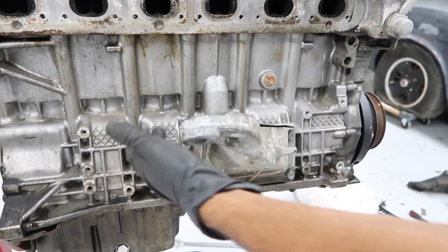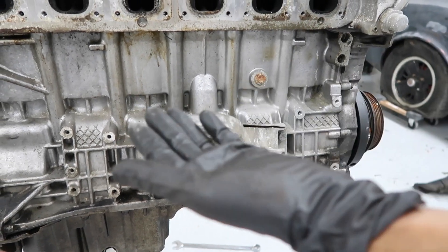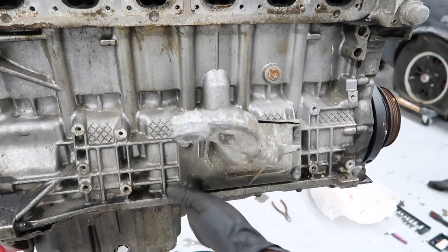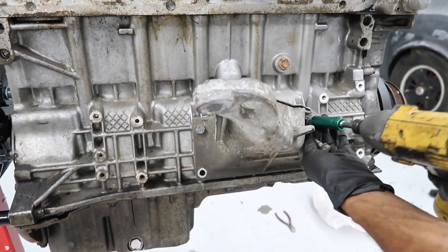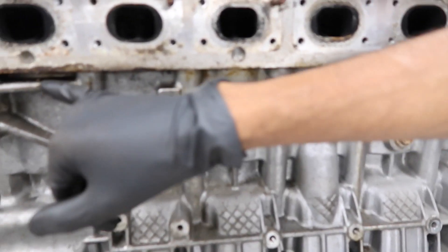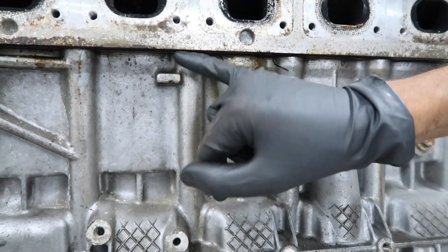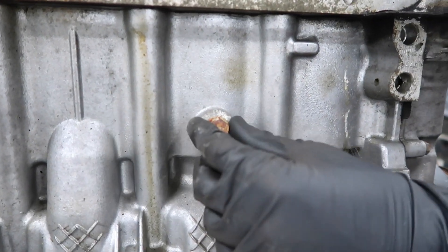The only thing to remember is which bolts it goes with. This M54 engine was used in numerous BMW models, so they have different configurations where you can move the arm around or use a different type of arm depending on what car you're putting it in. On here we're removing these four, and this is for an E46 — just as a reference for you guys. As you can see, there's a little oil runoff happening on this side of the block — that's where the head gasket is actually blown, allowing stuff to leak out.